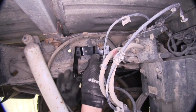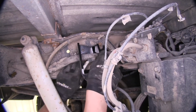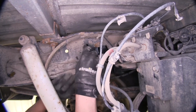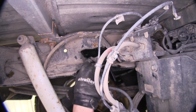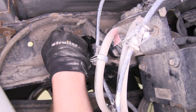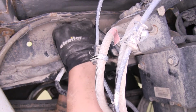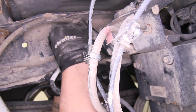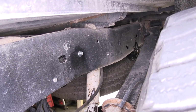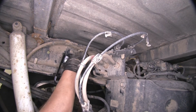So our bracket's going to go into place over our factory harness here. We're just going to leave this up there loosely while I grab the hardware. Now, with this bolt through our small hole in our frame here, just going to put the flat washer and lock nut on the back, hand tight, just so that bracket will stay in place. Now we can put in the other bolt. Okay, now we can take our larger bolt and we feed it through our frame.